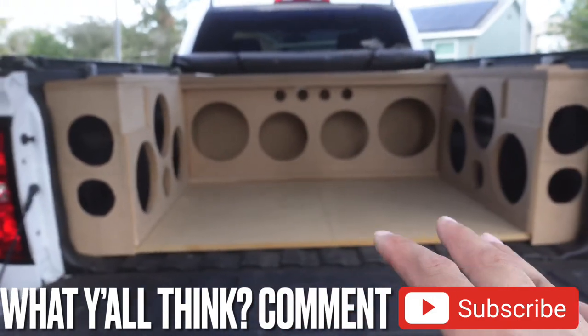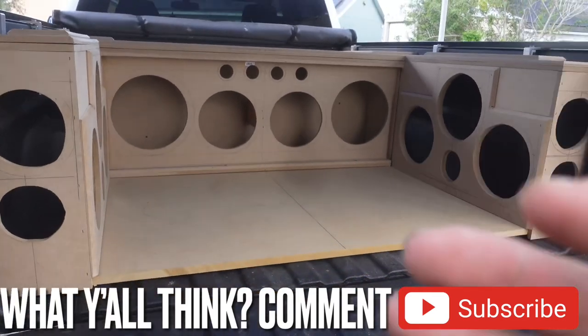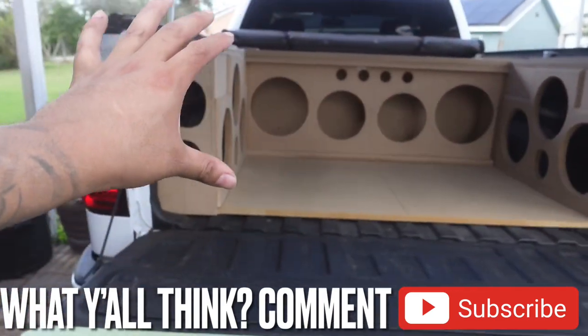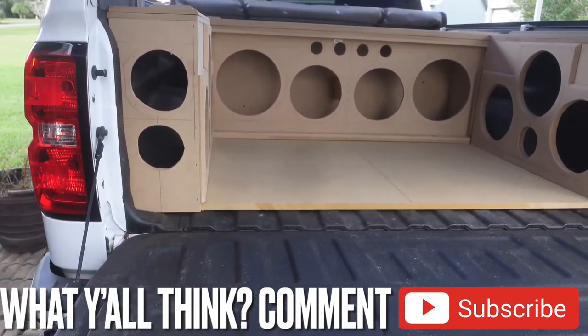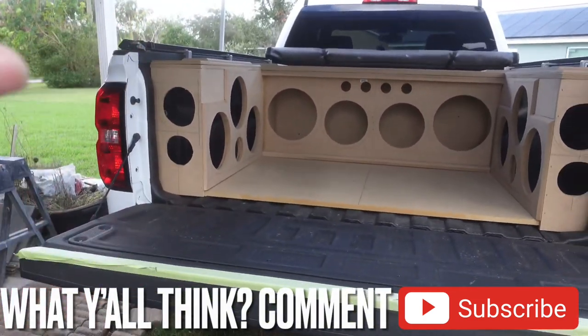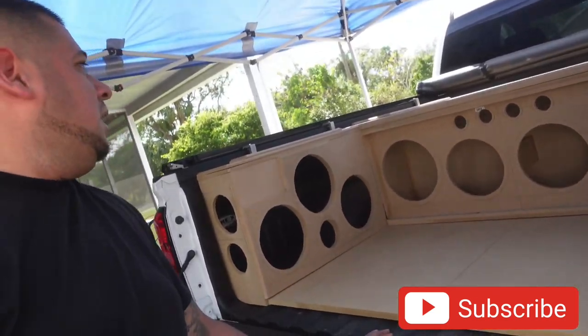I did the speakers facing in at each other to create better quality sound. The 212s and 210s are mid-bass to punch you in the chest, and we have four 12-inch Sundown subs to fill in that extra frequency gap and give all-around subwoofer sound. A lot of people have stunt walls but are missing that good bass because they don't design a good box or have the right firing direction. We're not going to have that problem — this thing is going to be a monster. Next up is the blow-through beauty panel and the amp rack, so stay tuned. I appreciate you guys watching — drop some comments, we're at 150 likes, let's get it. Peace.